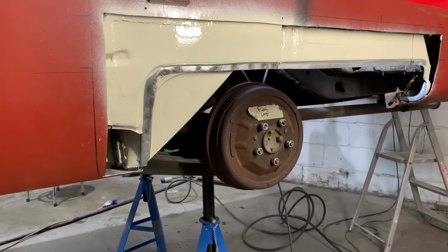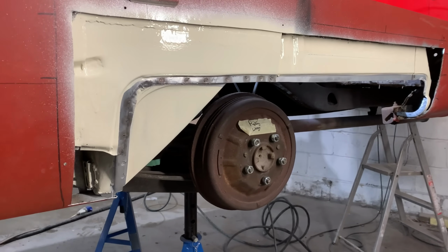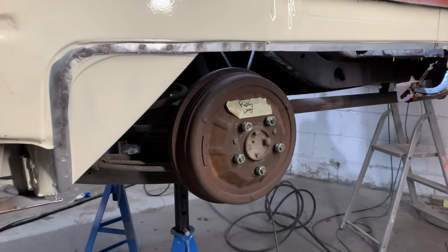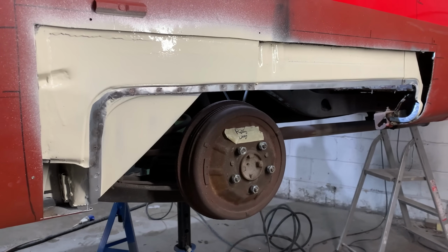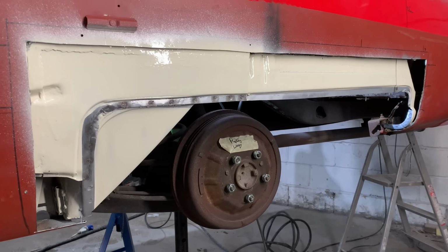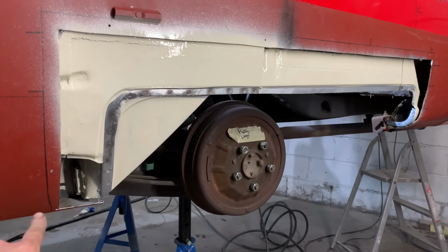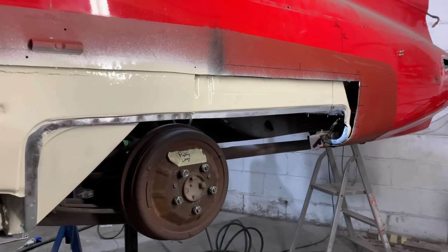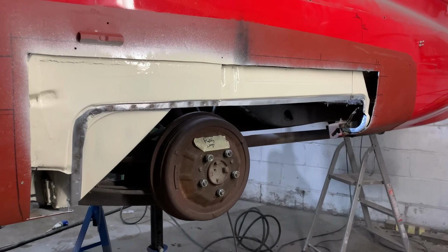We've got everything coated now in the Novol Classic Car Epoxy. So that's curing, and then obviously we've left this area here bare, because that will get weld-through zinc on it. The epoxy is awesome, but you can't weld through it. So that's the joining line there that this will be spot welded. So once this is all cured, we'll basically offer the repair section up and trim it to this line here and get that butt welded in, and that'll be one wheelarch repair section completed.